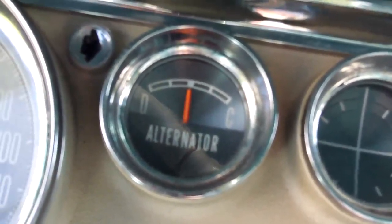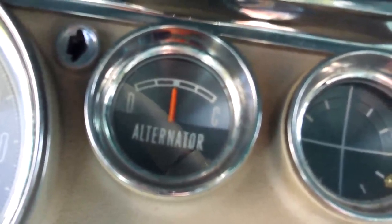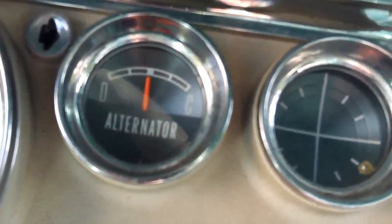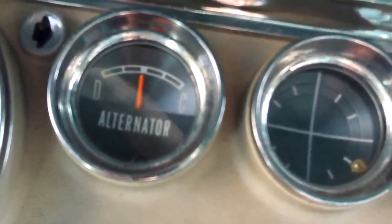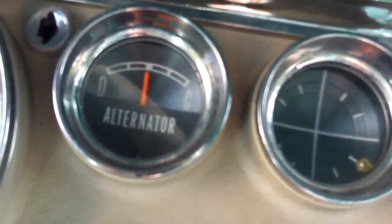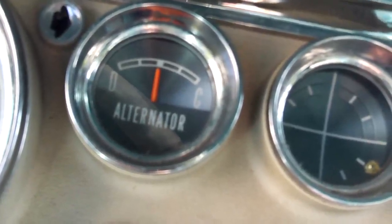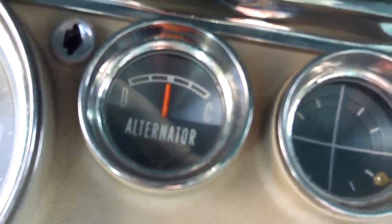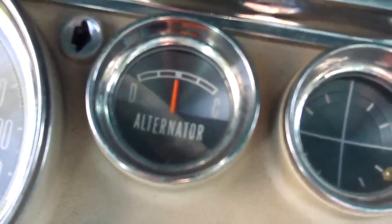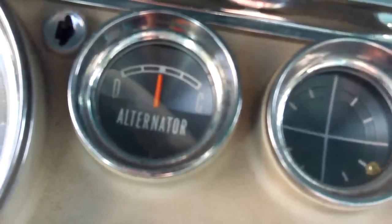Really I didn't need an alternator gauge anyway — that's where it all went bad. It turns out that's a completely common thing in this era of car. So having wired around that, everything was good. I wired the alternator directly to the battery as it should be, not passing through a gauge like this. I put some inline fuses in as well, which were missing, because they probably would have burned out in the engine compartment rather than behind this gauge. It's kind of a link fuse I have going on in there.